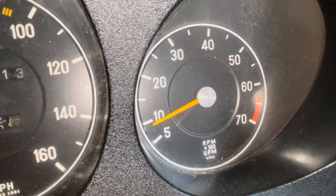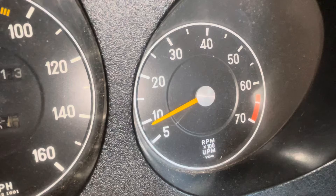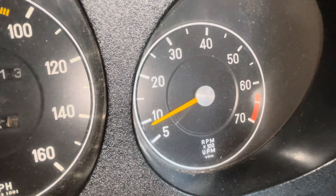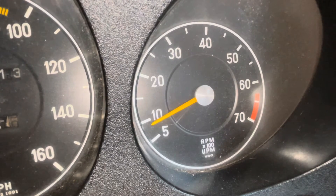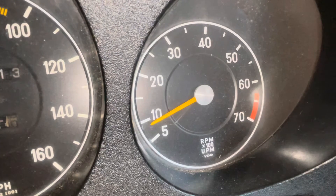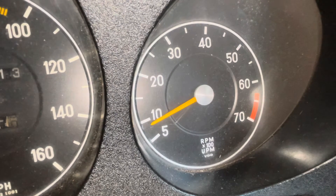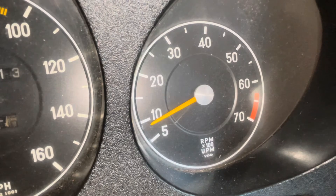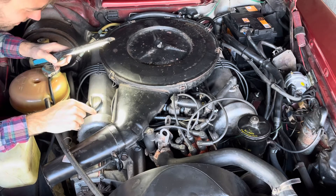It's about 8–9 degrees in the garage, the car is cold — let's see what the valve does. Actually, considering the outside air temperature and coolant temperature, I'd say that's about right. One issue with the auxiliary air valve is its behavior can be inconsistent — one day it works, the next it sticks. If it's not that bad it's something you can live with, but eventually it's worth having it refurbished. I'm quite happy with that — no misfiring or vibration through the cabin.